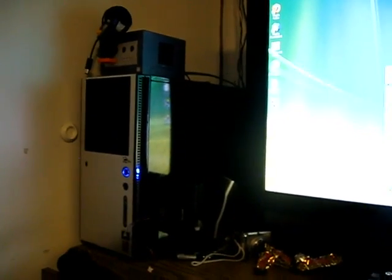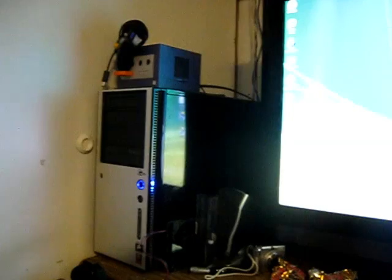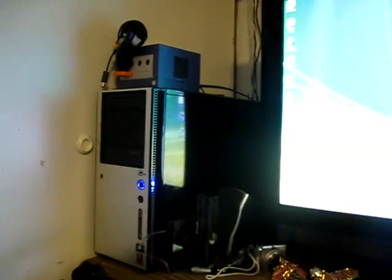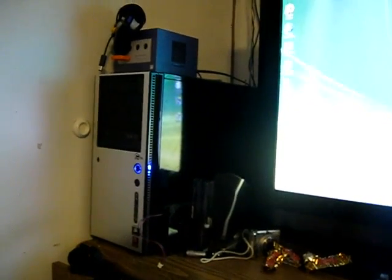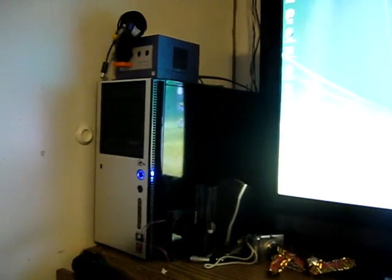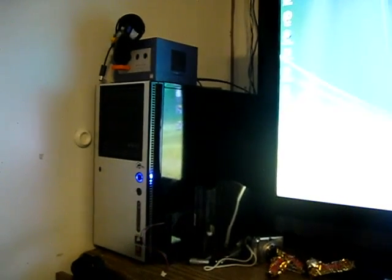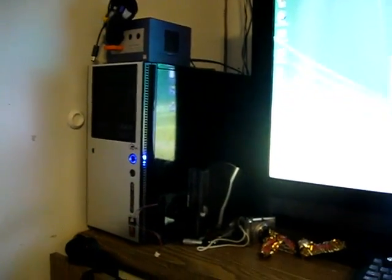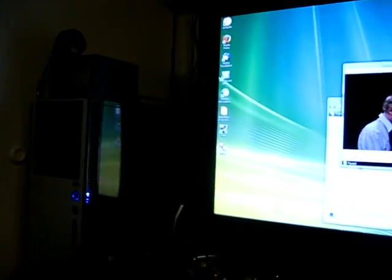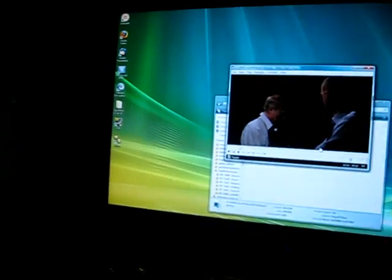The reason I upgraded, though, is that the P35 board, this is the DS3L, so this was a low-end board. It cost under $100 at the time I bought it, and pretty much stayed that way. But it did not like to overclock 45 nanometer quads. So the new Q9450, Q9550, Q9400, Q9300, all the new quad cores that are coming out that are 45 nanometer, the DS3L just does not like to overclock. It'll usually overclock them to about 3 gigahertz, maybe 3.2 if you really push the voltages, but that 3.2 is not going to be very stable.